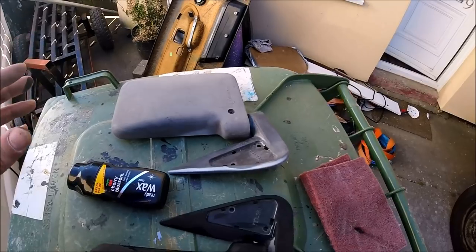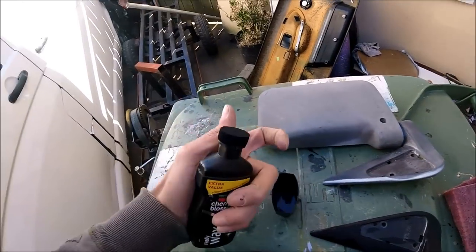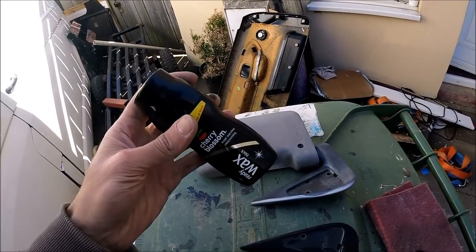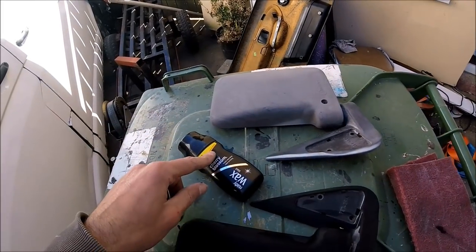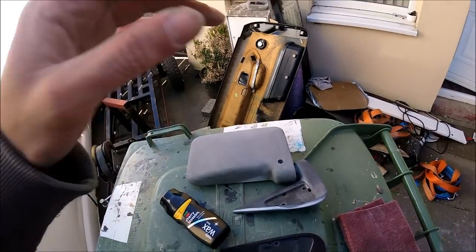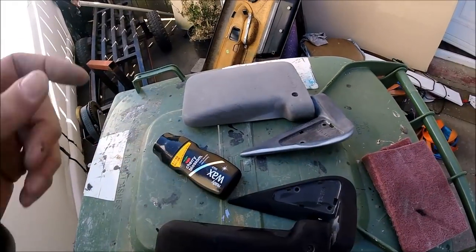If you're just doing small little areas like wing mirrors or small bits of trim, it's fine just to use the Cherry Blossom in the bottle with the foam applicator. But if you're going to be covering bigger areas like the bumpers, it's best to cut this bottle open carefully — because if you just slice into it the polish will fly all over the place — and pour it into a little container, then use a washing foam pad or something with a bigger surface area. That way you're not having to cover an entire bumper with a tiny little foam pad, so bigger areas: cut the bottle open and use a bigger foam pad.